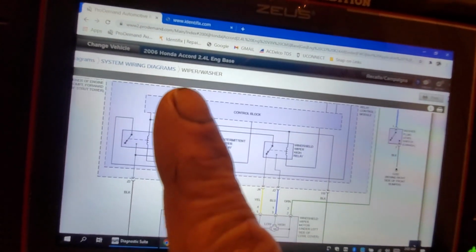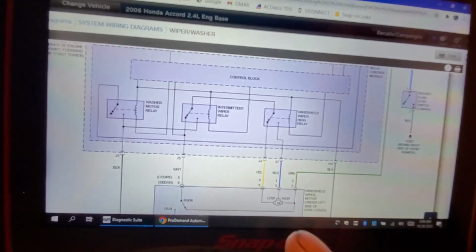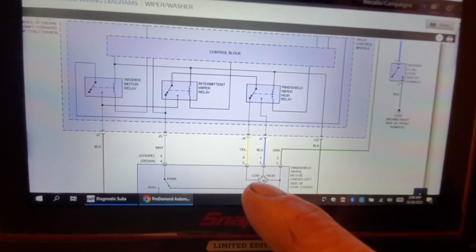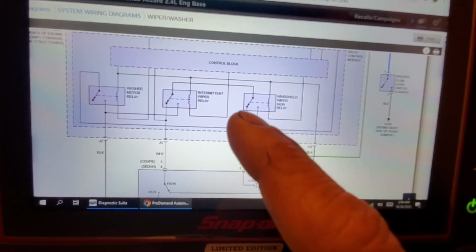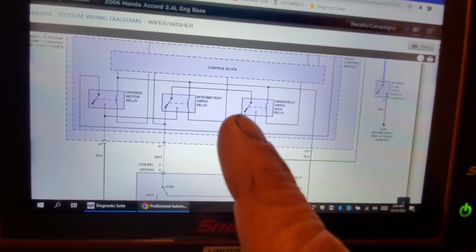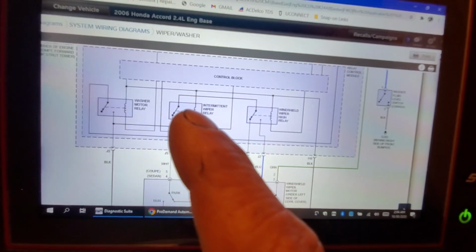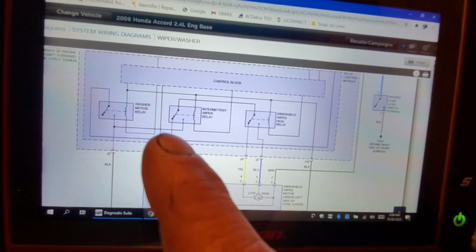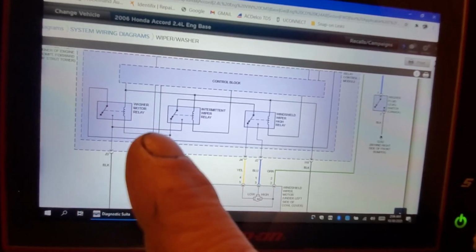And I'm going to show you the input side of this system in a minute. But same thing: we have that constant 12 volt feed coming in our green, going through the motor windings, coming out on the low side, coming up the yellow. This relay's natural state is in the intermittent mode, so it's naturally going to take this 12 volts, send it over, and close the relay, giving it that path to ground, and then release the relay.